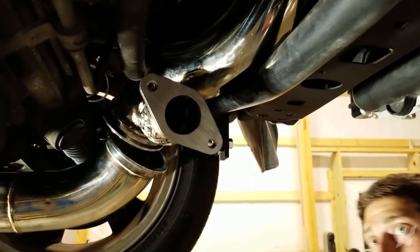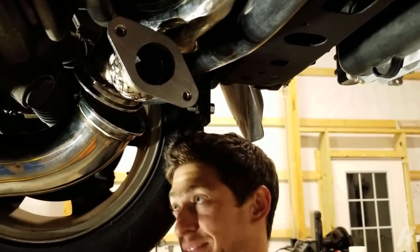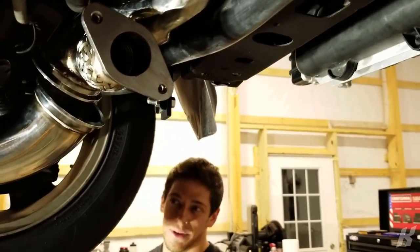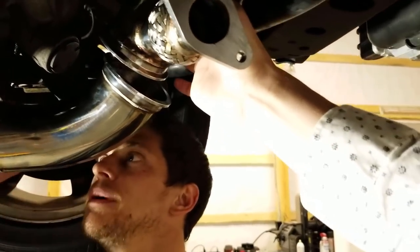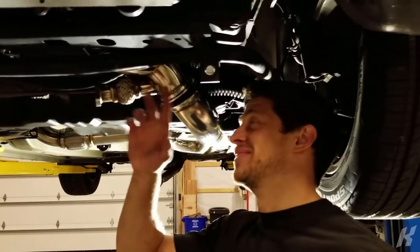That dent is so not at the right spot. I'm gonna listen to a YouTube guy that said nothing's gonna look like it's gonna work and you gotta bolt the turbo. That's the big thing. This bolts straight to the turbo. You bolt the turbo onto something fixed up there, then you see exactly where this ends up. I think this thing needs to be dented differently, and this one's definitely gonna need dented. How did they not already dent it? They said it was, but it's not. Maybe they forgot. I bet this all needs to be dented so it can be shifted up more. This pipe is hitting so many different things.